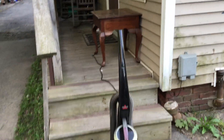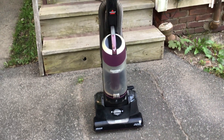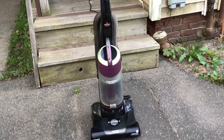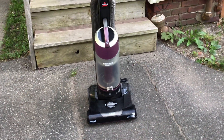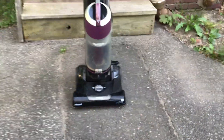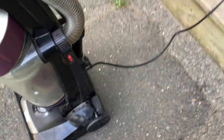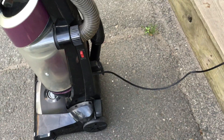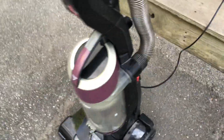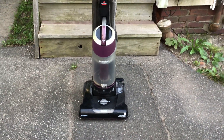This vacuum's got a new cord on it. The old cord was ripped apart — even the white and black wires had exposed copper sticking out. I didn't want that to be exposed, so I took the plastic housing apart, removed the old cord, and put this new cord on. I tested it and it works fine, which makes me very happy.